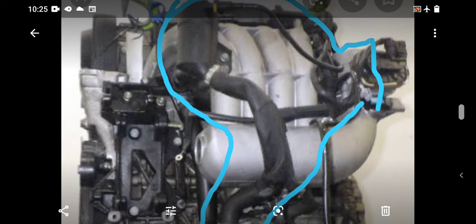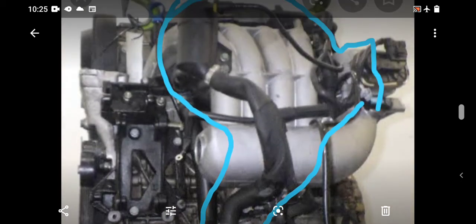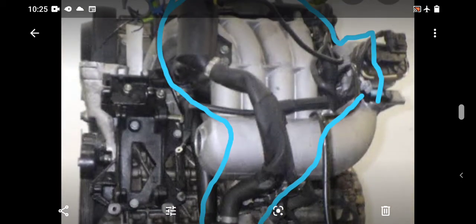Oil vapor passes through these hoses. So when you leave them open, you are sending it straight. Look at where it comes from, even direct from the sump, the oil pan. So when you now remove that hose, what do you think happens? That will be entering your oil pan direct, mixing with your engine oil. It doesn't even need to go through the piston and rings, which may take some time before it eventually enters the sump. This one goes direct into the sump.